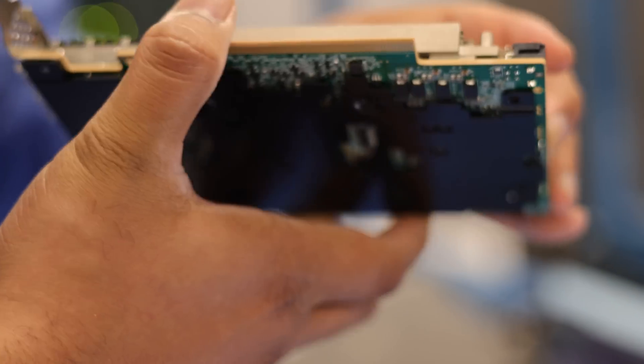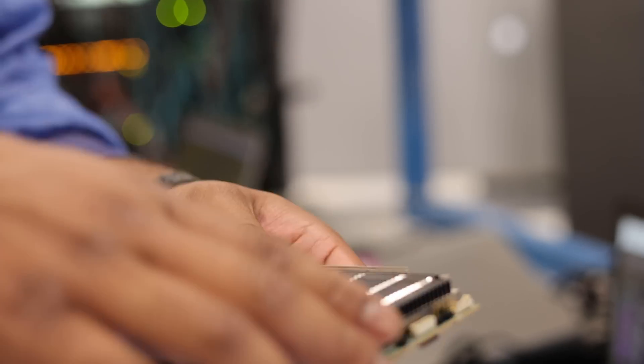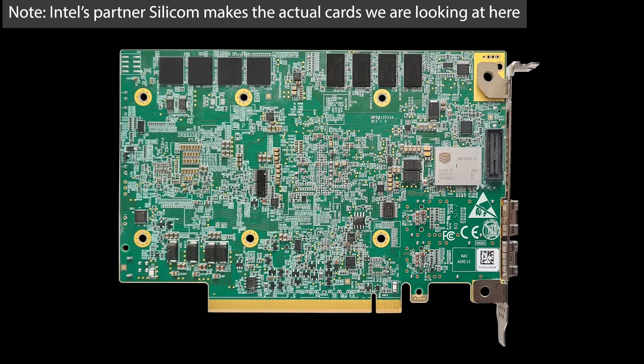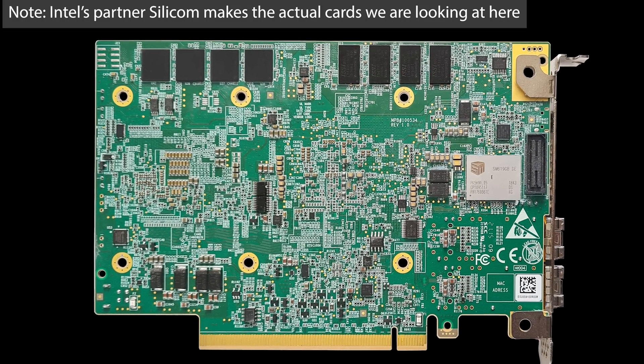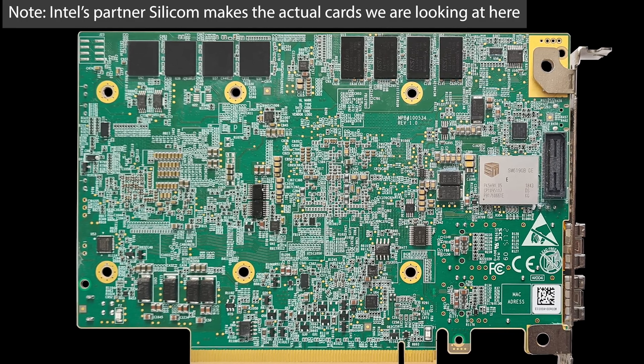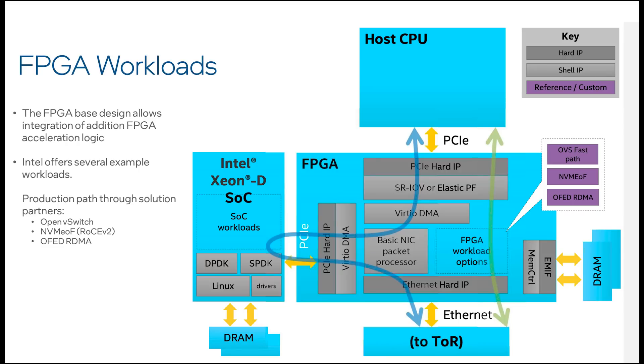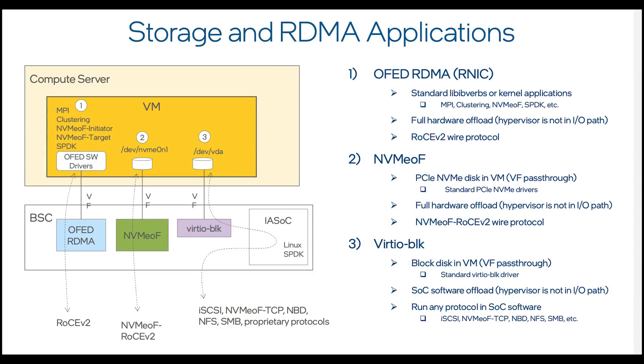Because this is an FPGA-based solution, the infrastructure provider can actually encrypt and compress data before it leaves the system — you can put your own algorithms in that data path without using system resources. We're being limited by network bandwidth in our demos, but if we had inline compression on the FPGA, we could potentially see a sequential performance jump because data gets compressed before being sent, lowering network bandwidth and congestion costs. Since the IPU brings storage over the network, it can offload not just the NVMe over fabric stack — cloud providers that encrypt all traffic going in and out of servers can have private tunnels created and managed on the IPU, which is a pretty awesome capability.